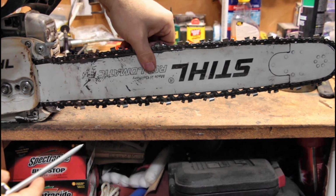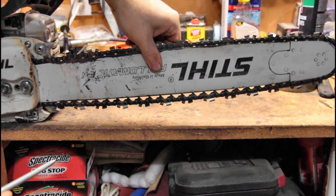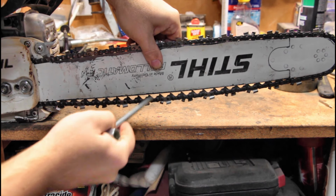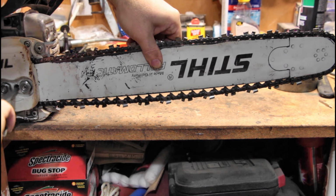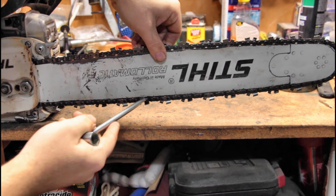And so I pull up on the bar, and you can see there's some movement there. Pretty much all chainsaws have this. So I pull up on it, and you can see that that increases this gap here. So I hold it, and I tighten it just to where those guides are sitting